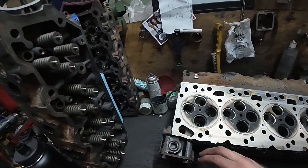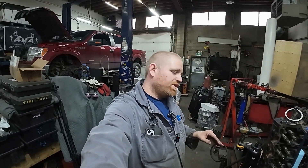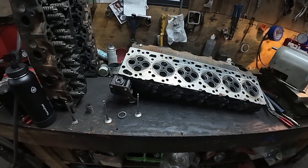The valve depth was at 65 - intake and exhaust - and you can play around with a bunch of that stuff. When we put this engine together last year we were in a time constraint, so I went with specs I knew would work. The tighter you can get tolerances and play around with airflow, the better - it's well worth the time - but the customer has to have the time and the ability to pay for it. The engine worked and put in lots of work.